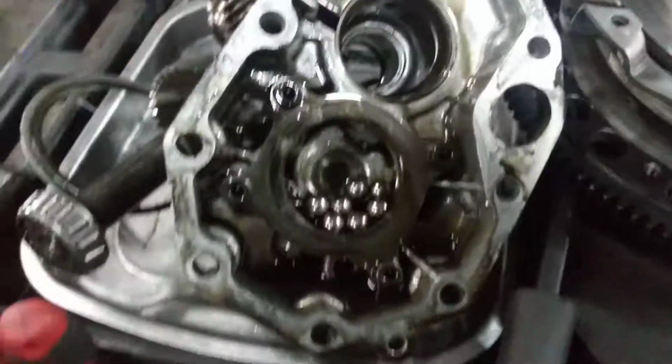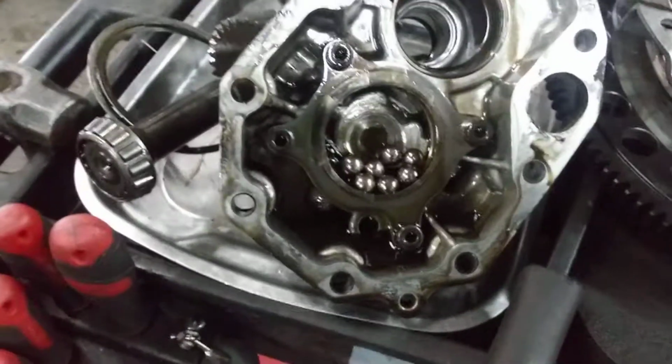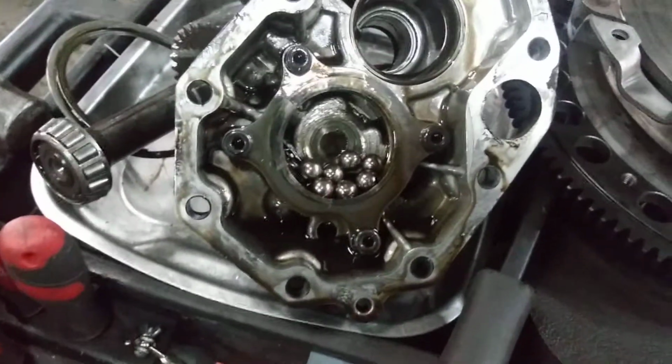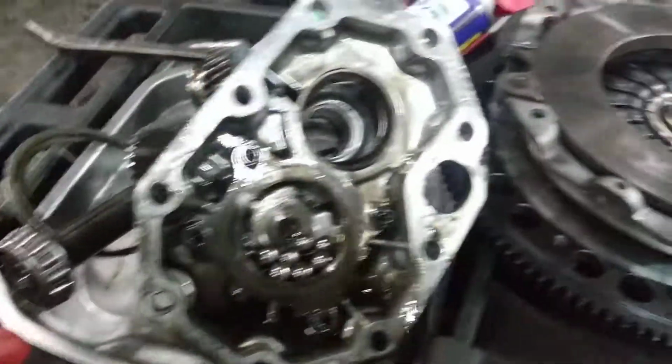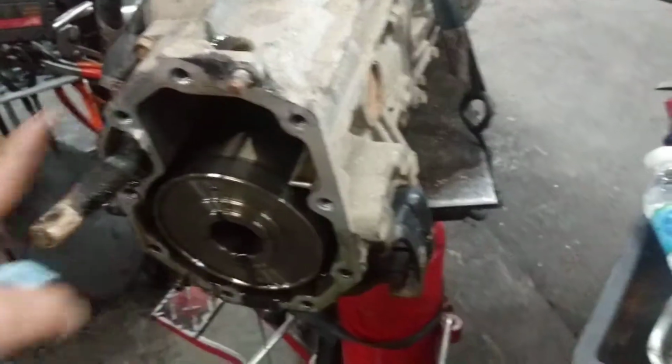Now my problem is right here, the output shaft bearing is gone, my friend. This guy no longer exists within this realm. He's somewhere else. And so yeah, anyway, you take the tail housing off, take the screws that go around here,